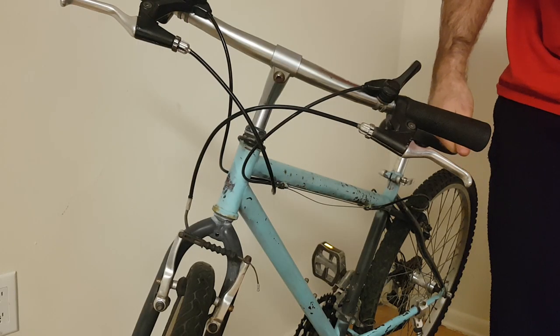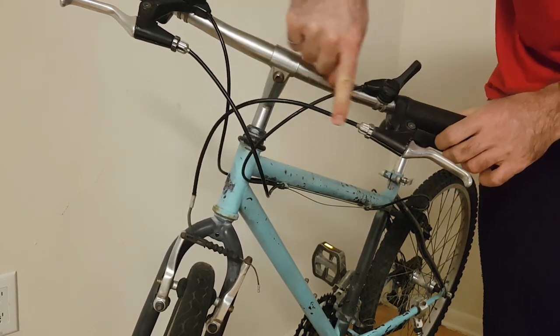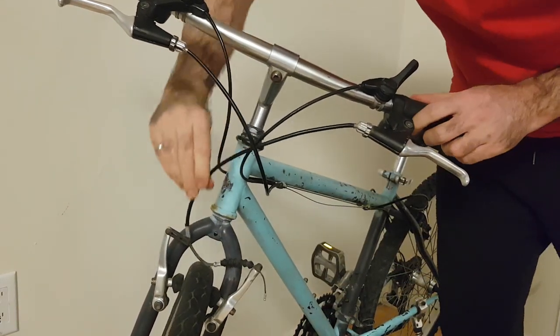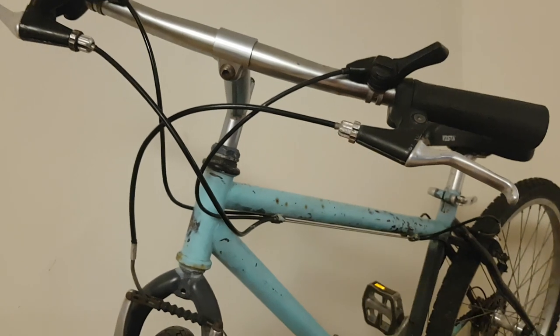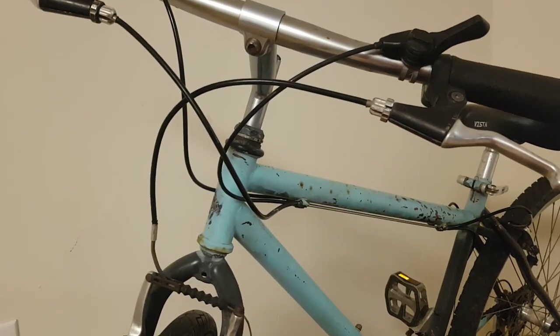On most bicycles, this trick isn't really possible for cables which are for front brakes because there aren't any sections of this cable which are exposed. As you'll see, if I disengage these brakes, there really isn't anywhere for this cable to move to because there are no exposed areas. That being said, this cable is quite a bit shorter than all the others, which means that friction isn't quite as big a factor, so keeping it lubricated isn't quite as important.